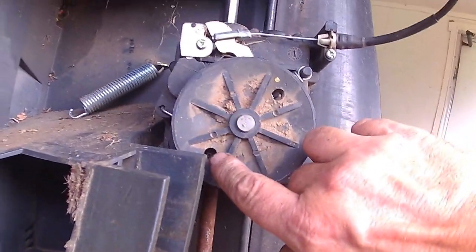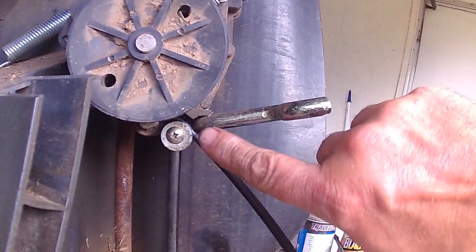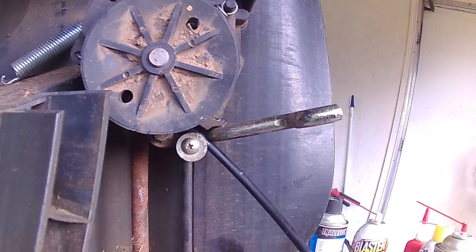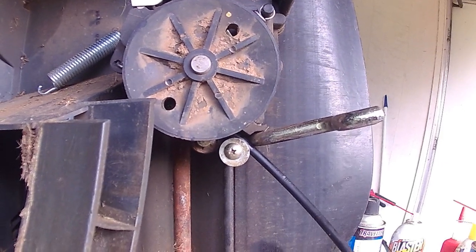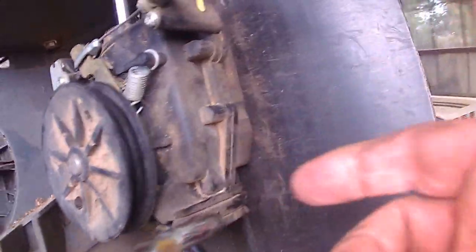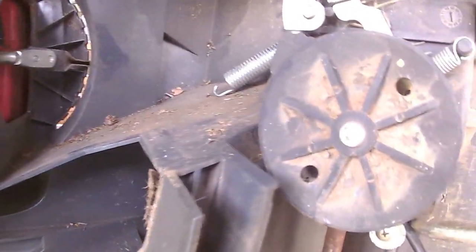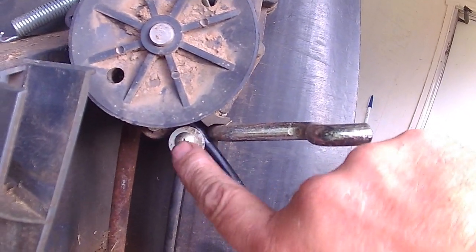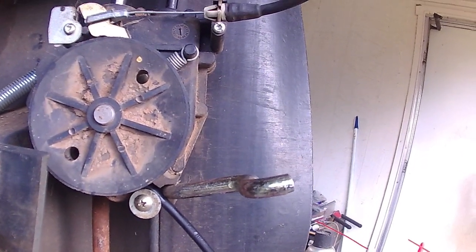Just to recap: there's a Phillips screw inside that holds the tab attached at the end of the cable, and this Phillips screw right here holds the cable in. It takes a little working to get that in there — you have to hold the screw with needle nose pliers, put it in sideways, and work it around. Then while you're still holding it and it's in the slot, look in from the back and start your threads. After that, tighten it down, adjust your washer, tighten that up, and finish reassembling as shown in the other video.